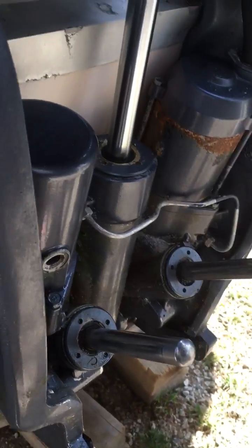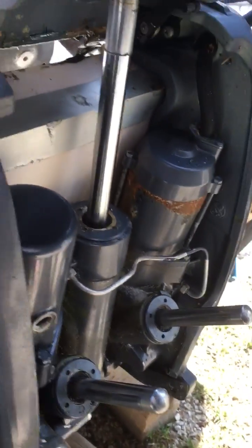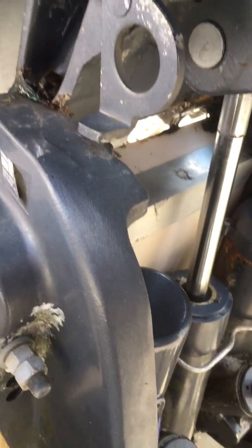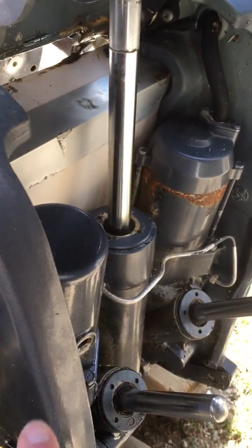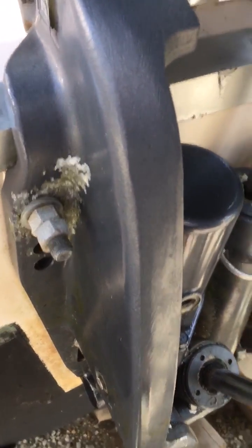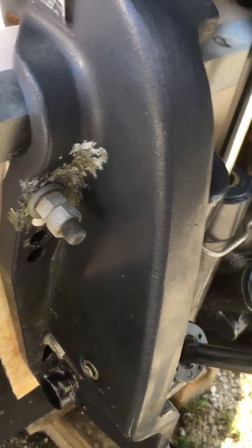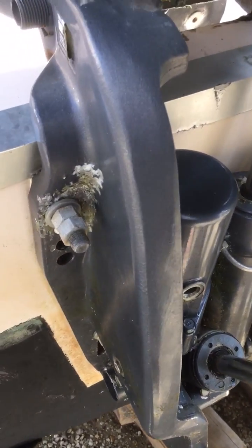Good luck. The other thing is — you want to lock it off before you take the bolt out. I've seen some videos online where they put the engine up and down while this thing is open and the fluid spooges out. That's all you're doing is emptying the thing — it's not doing anything for you. So don't up and down it.